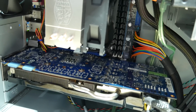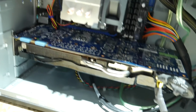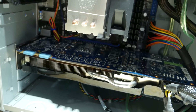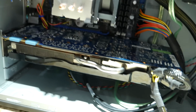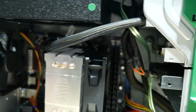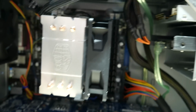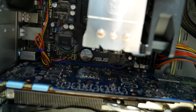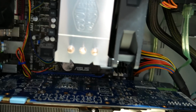Well, this is not very encouraging. I can hear the relay turn on the power supply when I press the button, but nothing else. So I know it's actually getting a signal from the motherboard to turn on, but for some reason absolutely nothing else is happening. I wonder if it's because the battery was removed from the board. Maybe I need to reset the CMOS.